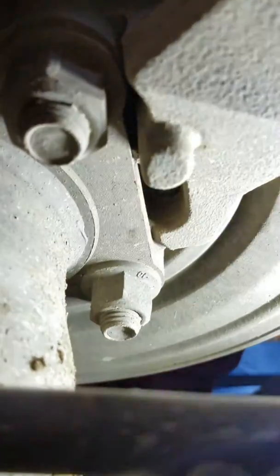You have to reach in from the back. You have to go around here to the back — little hole right there, see where Adam's finger was? And you have to reach in with a crooked screwdriver, which looks like that, and turn it up and pry each gear until the brake gets tight.